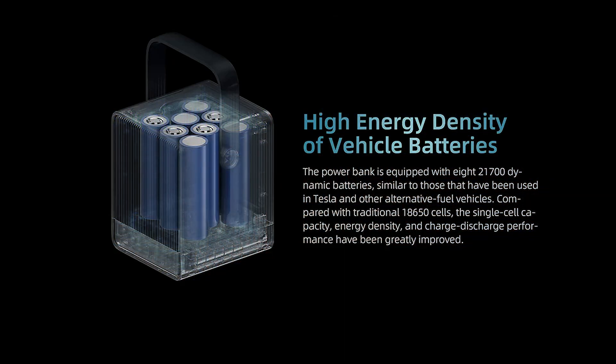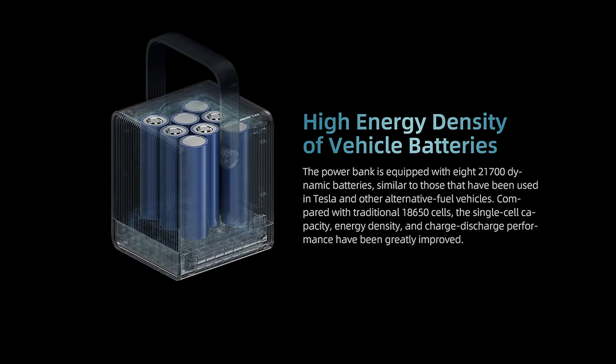Here are a few really important things to keep in mind when comparing the CookTech P Plus Series with other products. The first is battery chemistry — it seems simple, but it's super important because it's at the heart of the product. This unit uses the very latest 21700 batteries, used in many EVs on the road today. A lot of other power banks use the older 18650 cells — they're okay LiPo cells, but they don't offer the same benefits. The 21700 gives you more charge-recharge cycles so the unit lasts longer, holds charge from Monday to Friday without decay, and packs more energy density into a smaller box.